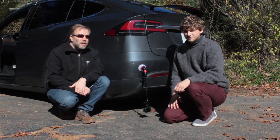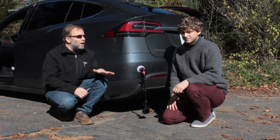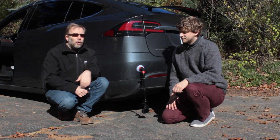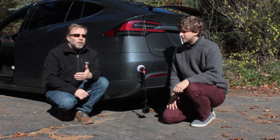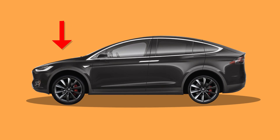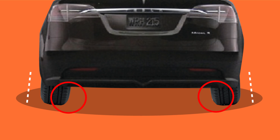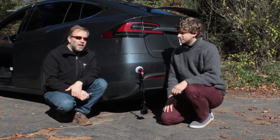We're doing this video to let you guys know — all Model X owners. All Model X's that we know of right now have air suspension, so you're probably out there raising and lowering your car and having fun. But just know this: when you go into very low, the camber is changing like Jesse explained, and you are wearing out the inside of your tires. So don't drive in very low for very long, or you'll be doing premature damage to your tires.